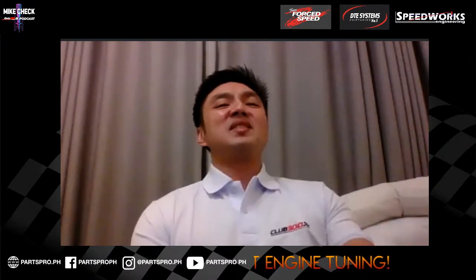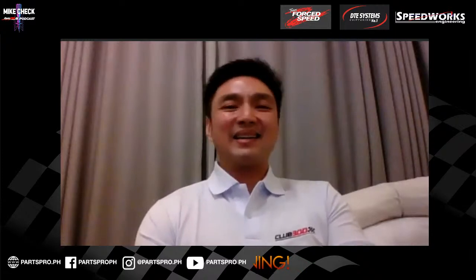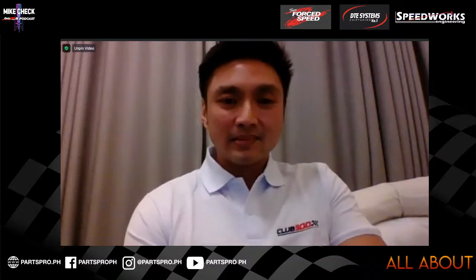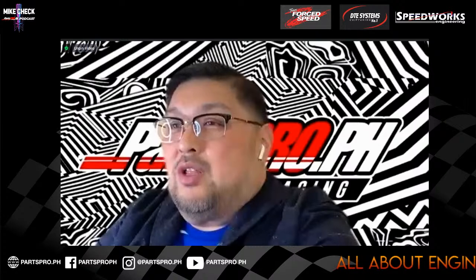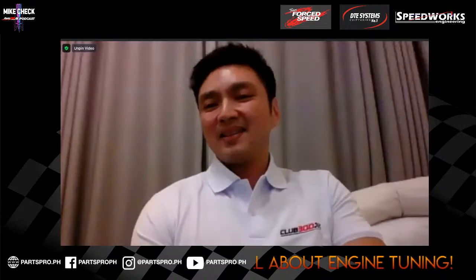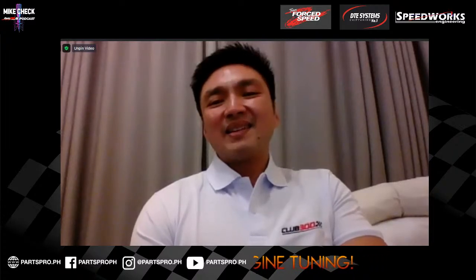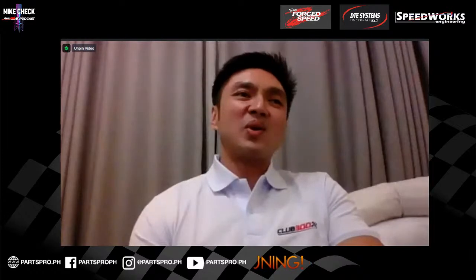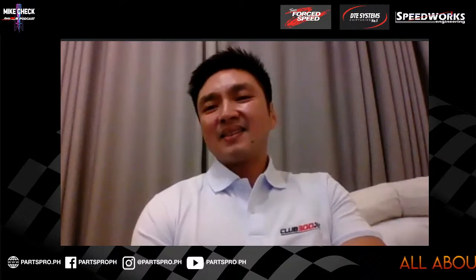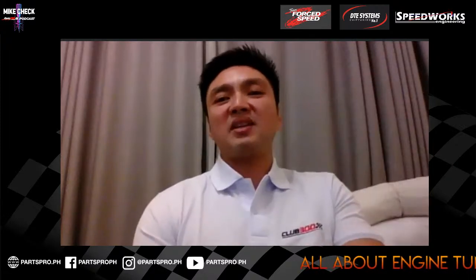Even if it's in third gear at 2000 RPM, it will move forward because of the gearing and the transmission and everything. Have you seen a stock dyno of the new Supra or the new BMW Z4? They make about 340 at the wheel. That's not bad, considering it's 380. Yeah, but with just a tune, you get them up to 410, 420 at the wheel already. And with mods, with a downpipe, you get to about 430, 450.